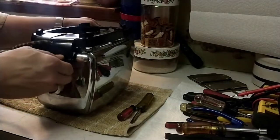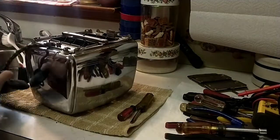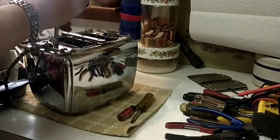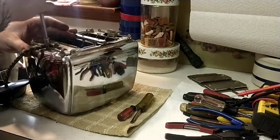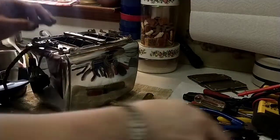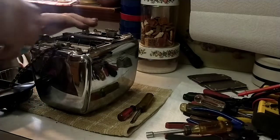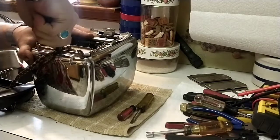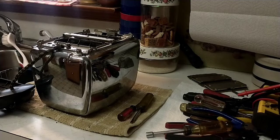and once you get to that point, you have to pick your cord up, just like that, and then you lift that. So, this looks like, yep, 5/16 inch nut driver, and part of the case actually crimps to create a strain relief for the wire, so I'm going to have to undo that without breaking it. So I'm going to go ahead and get this disassembled, and we'll get back with the case off and the old wire removed.